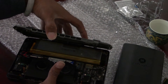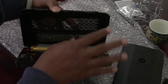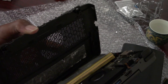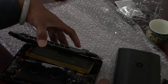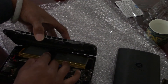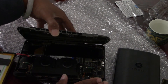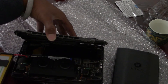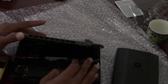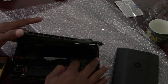If I pull too hard I know it will break and I'd damage the plastic. I had to take my time — all this glue underneath the back is fused to the battery. I had to use this pry tool and gently work off the glue from the battery so I could put the battery off to the side. Then I unscrewed the fans, removed the 512GB SSD, and input the SATA 2TB — really having to take my time while holding the device and gently inching the SSD into the mount.